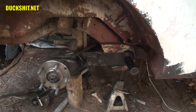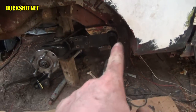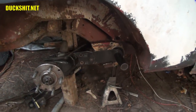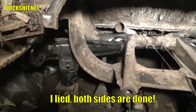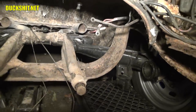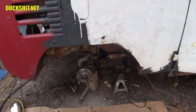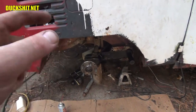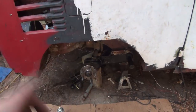Everything bolted on there real nicely. I think that spring plate is still going to come out — I'm probably going to cut up the Bus one. I thought I was going to go back to the Beetle one, but the Bus torsion bar will not fit inside that tube. I thought maybe I could trim out the inside with a lathe but I'd probably just make it too thin. Anyway, we're going to wrap this one up. We got one side all pretty much done except for the spring plate. Like, comment, subscribe, and click the notification bell so you get updates every time I upload a new video. Don't forget to check out duckshit.net for all my different social media links. Check out my Instagram — you're probably going to see some stuff you haven't seen me do yet. Thanks for watching. See you next time.